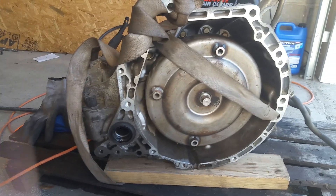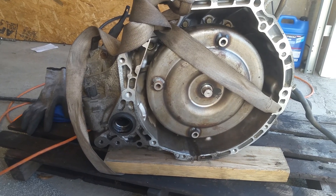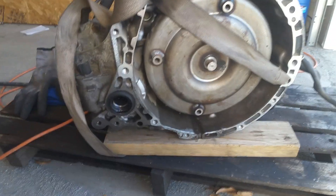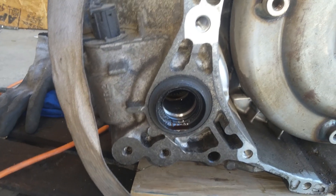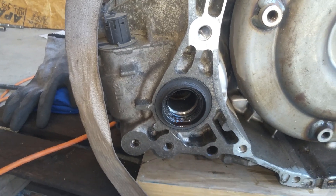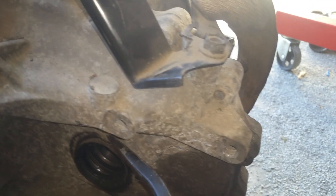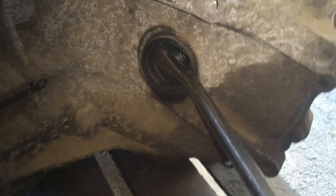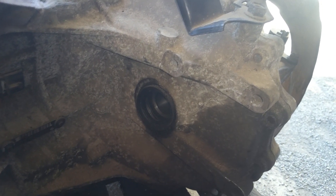This is a transmission from my 2004 Nissan Altima. I'm getting ready to put some new transmission seals in. Right now I'm getting started on the CV axle seals — these are the ones that usually give you the most trouble and need to be replaced. We've got one here on this side and another one on the back side. I'm just popping these out with the pry bar, getting in behind there and giving it a little tap to start working those out.